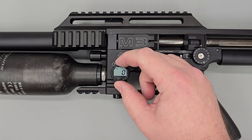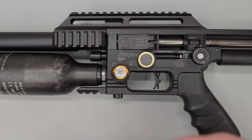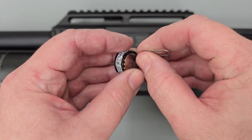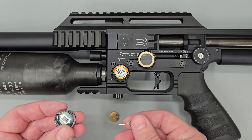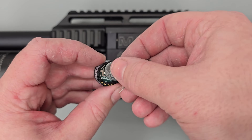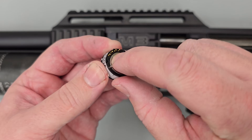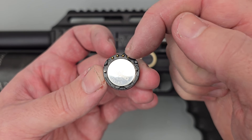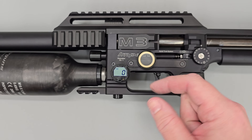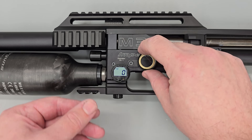To replace the battery, just unscrew the bezel, put it safely to one side, and remove the centre section. Flip it over and you'll see the battery in the bottom. Use the included tool to get in the side of the battery and lever it out gently. Take your new battery — the plus symbol needs to be aligned with the top — and carefully push it into position without pressing directly on the screen.